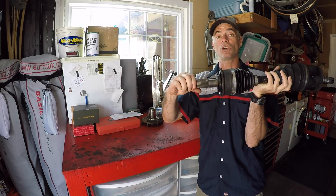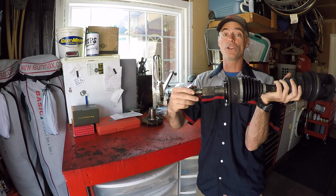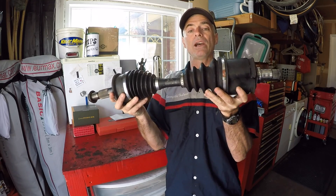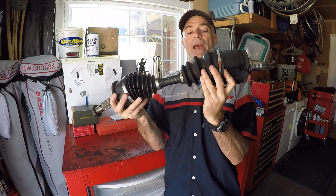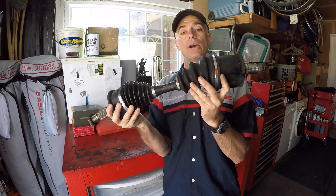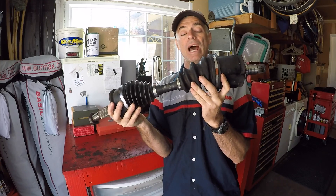For this reason, when the wheel's turning, the CV axle is turning — basically all the time. So when you have a lifted truck, your CV angles are going to be at a more extreme angle. When they're at a more extreme angle, the joints are going to wear out quicker and you're going to go through more CV axles.